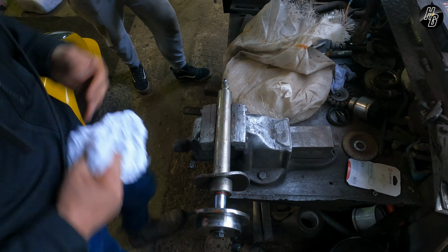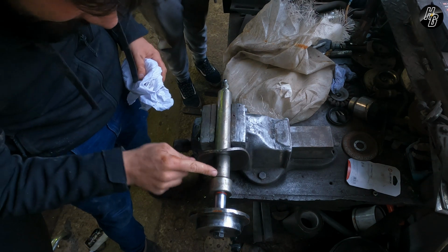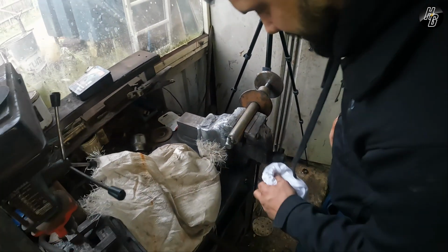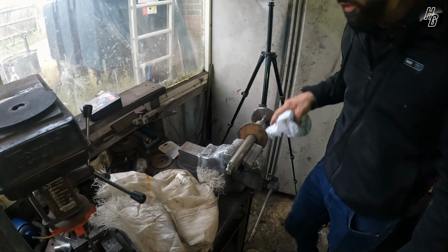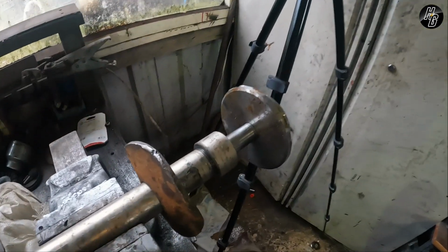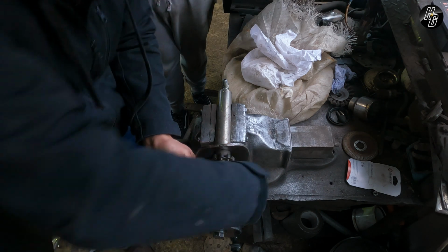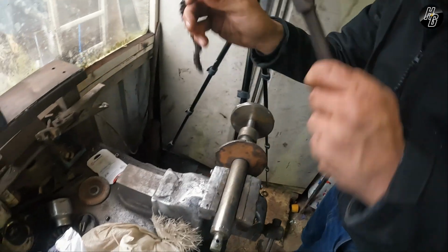Okay, so here's our ram. So I've now got to learn how this comes apart, and I'm pretty sure that is threaded. You can see a thread in there, Dave, see that? And that is a normal thread. So what we can do, we're going to take a pair of grips, and I'm just going to turn that anti-clockwise. Oh! There we have it. That is loose.